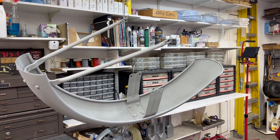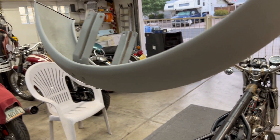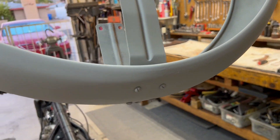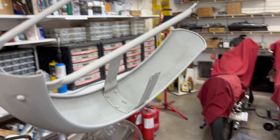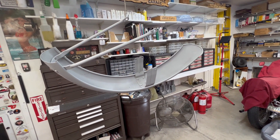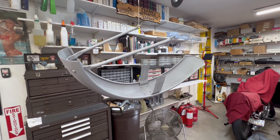Well, step one is complete. I sanded and buffed and sanded and buffed and buffed and sanded and buffed. Then I took it outside and gave it a really thick coat of primer — one coat, two coats, three coats, I don't know how many coats. I just kept going over it until I got a nice thick and smooth surface where all that pitting was. I'll let it sit overnight, and tomorrow I'll probably put another coat of primer on it, let it sit during the day, and then sometime during the day I will start the coats of black paint to turn it into a black front fender. I think we're going to have a fender that's not too ugly.